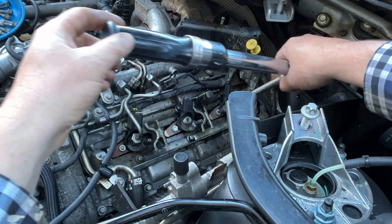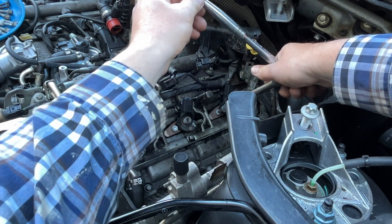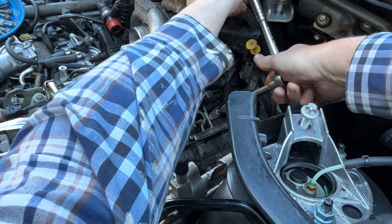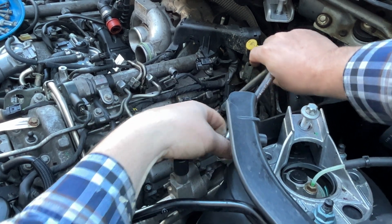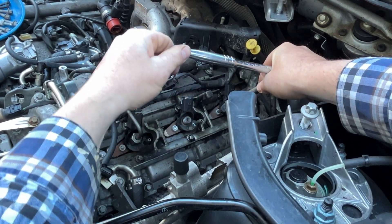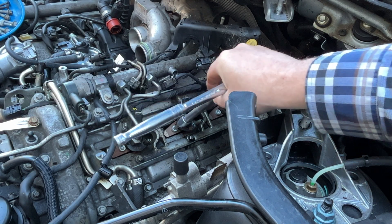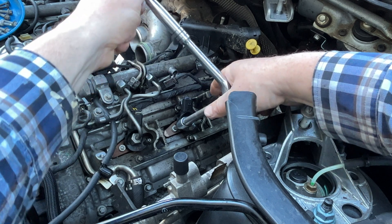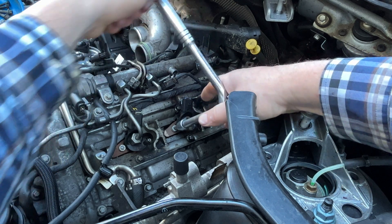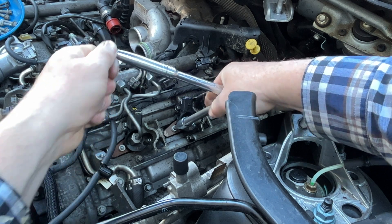Now we go another 90 degrees — from here to straight up. You can really feel it getting tight. That's 90. Let's do maybe another 20 to 25 degrees or so — I don't want to snap that. And then this one as well, get it to 90. Definitely feel it tighten right up. That's 90, and maybe just a little more. Alright, that's all I'm doing.